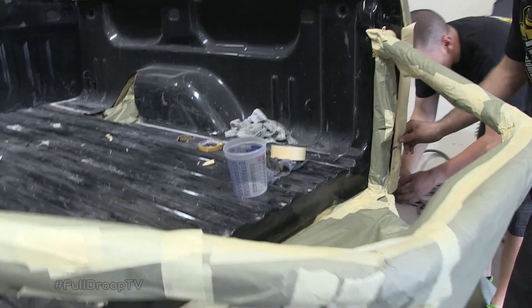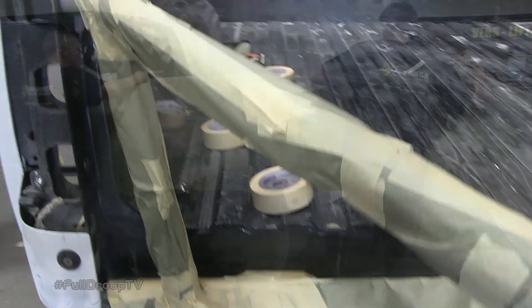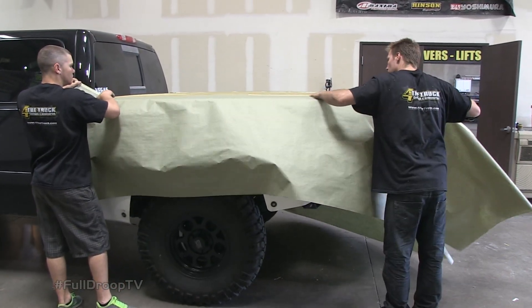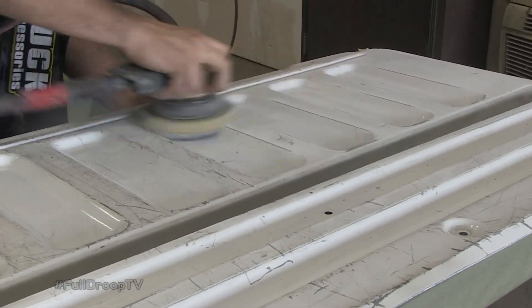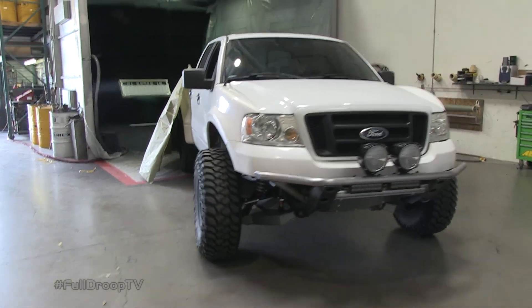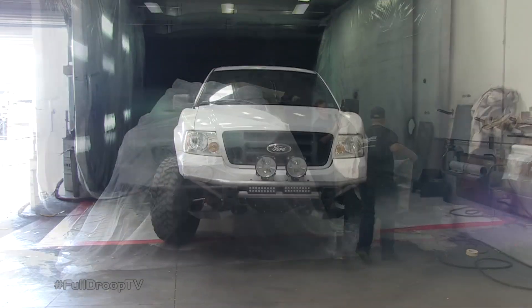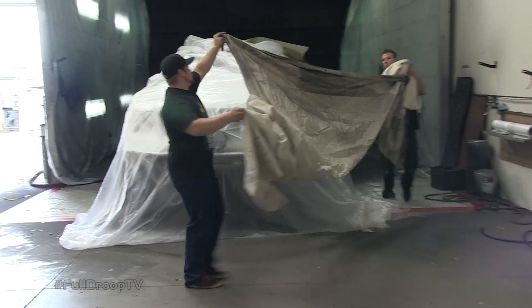A truck that's basically with factory paint — we'll jitter sand it all down. Not take the paint off, but get rid of the sheen on there. That way we have a nice bite for the Line-X liner to grab onto, but we're not taking it down to the metal where we could have rust. The correct application is to just sand the surface enough to where it grabs. Prep it all out. Use wire trim tape for the edges — no knives or anything to cut it up — so it looks great when it's done with a nice tight, even texture to the whole thing.